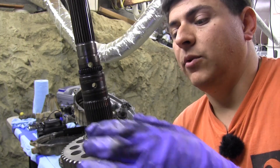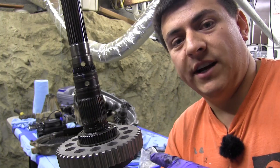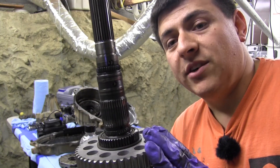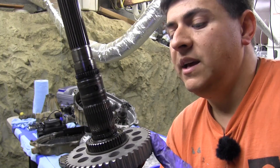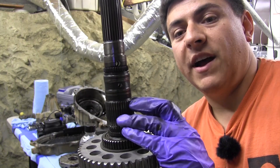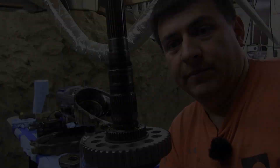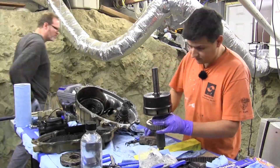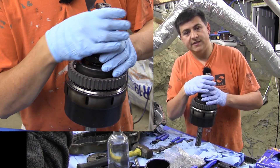Combined with that $400 Verilock unit it's about $500 to $600 depending on where we find the parts to make four high work — it's just not worth it for our application. We still need to put the Verilock unit back on because it's what holds the roller bearings inside this sprocket to the main shaft. This also explains the large amount of metal we found in the transfer case — there was a decent amount of metal at the bottom, which we initially thought came from the sprockets and chain, but it was in fact from this worn main shaft and the corresponding splines inside the Verilock unit.